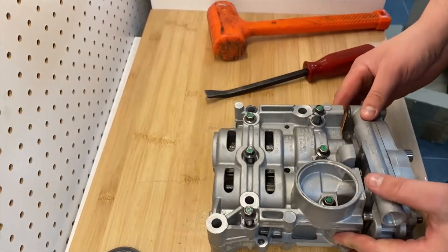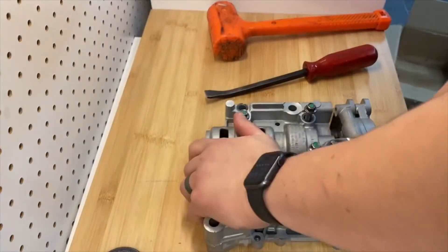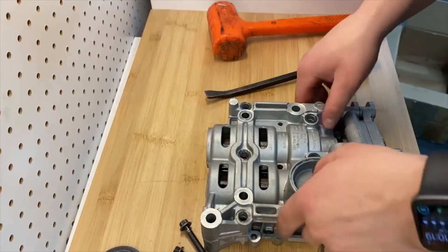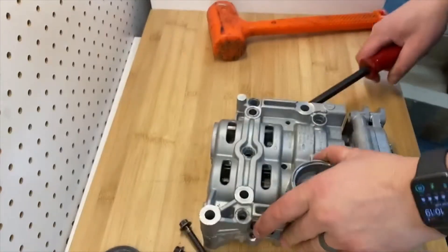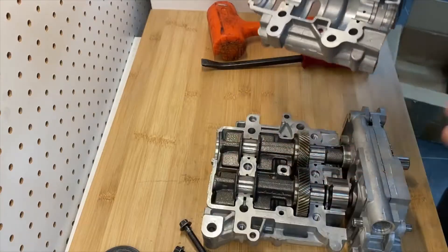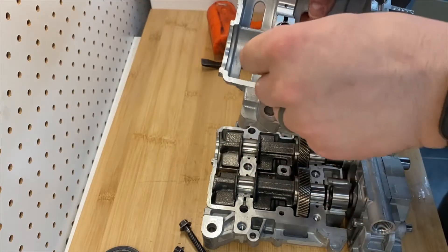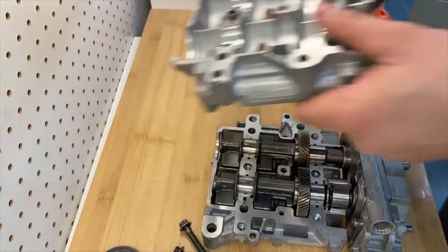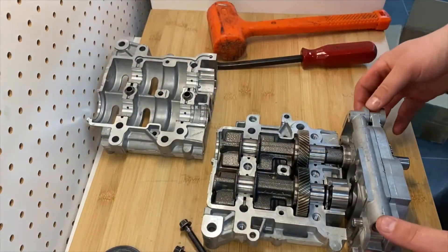Once you've gained access to that bolt, you begin the removal process. It gets a little frustrating but it's just a slow process — slow and steady wins the race. Once you get this hidden bolt, you're going to be able to open up your case. Once you remove this, you must clean all your surface areas properly and inspect them for any signs of damage before continuing on. If it is wiped out, burnt up, or discolored beyond what you believe is acceptable, it needs to be replaced. Get another used balance shaft assembly and start again.